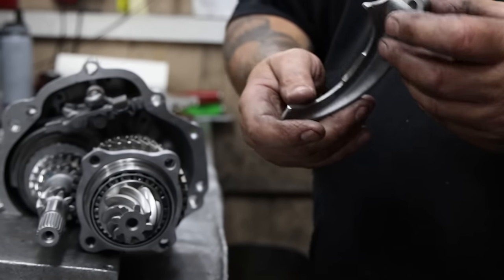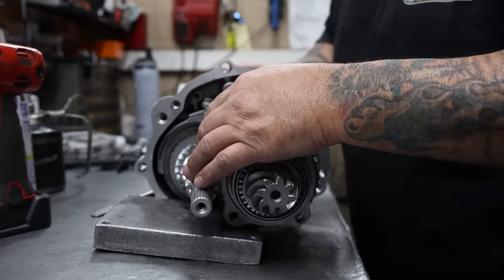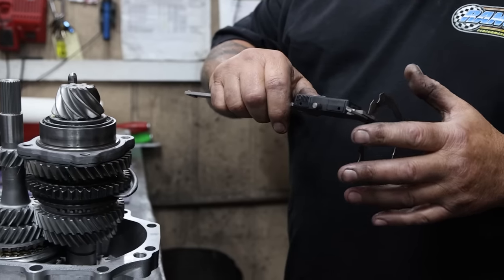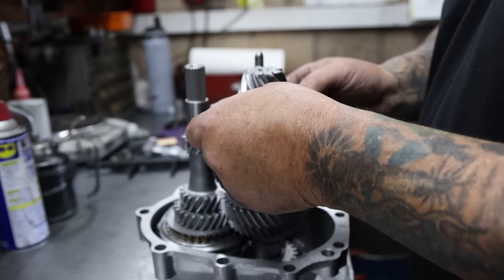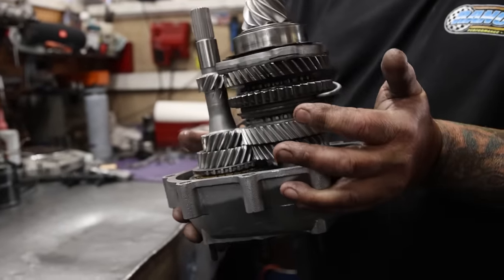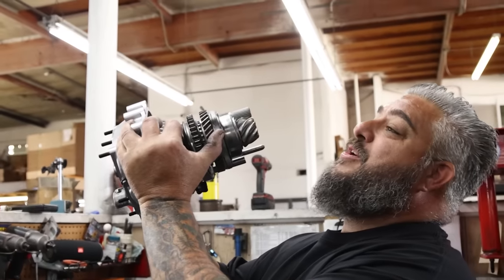Put our 1-2 in — love that positive flick flick. This is a late 5-millimeter, which is better, a little stronger, so you don't bend your forks. It's a 437, so we want about 35 thousandths — spot on. Set that in place. That's ready. This is pretty beautiful — it looks like you could almost eat it, like a big sundae.